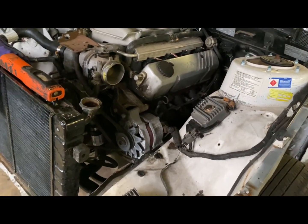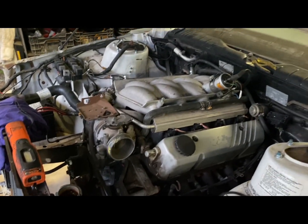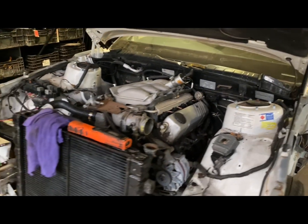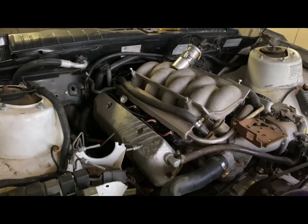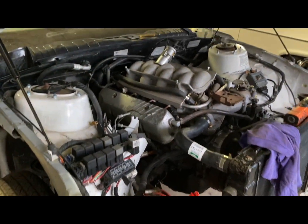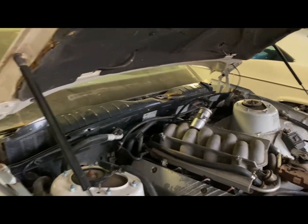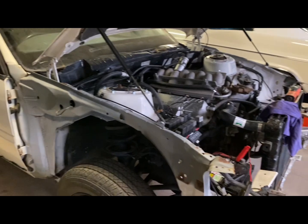We've changed over the ignition module. So we've had a good look to try and get it started. We've definitely got the fuel pumps working. We've got fuel coming out the top. So we've fixed all that up. So it's definitely getting fuel, but we're struggling to actually get the car started up. So I'm going to try working on the distributor tomorrow, see what happens as a result of having that checked, and fingers crossed the thing comes to life.